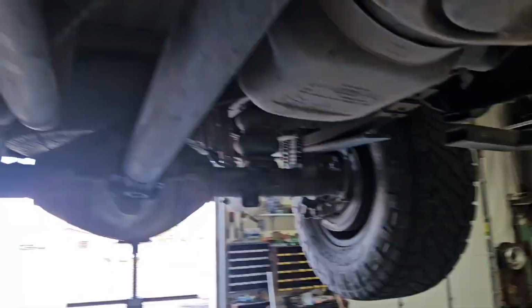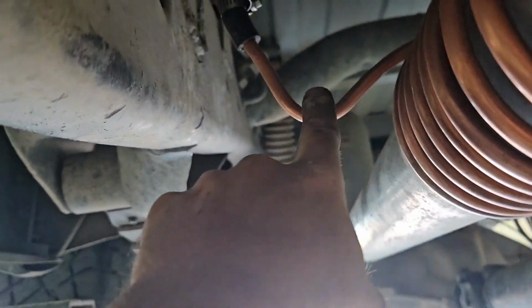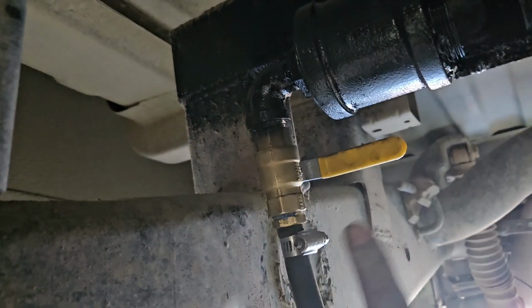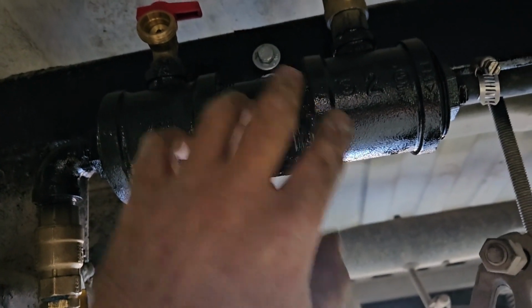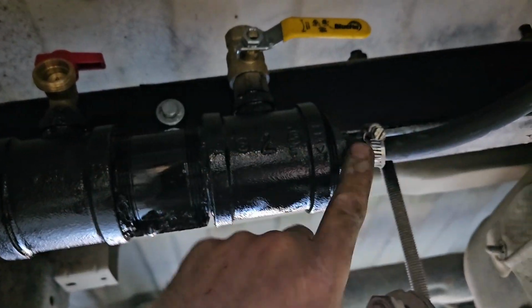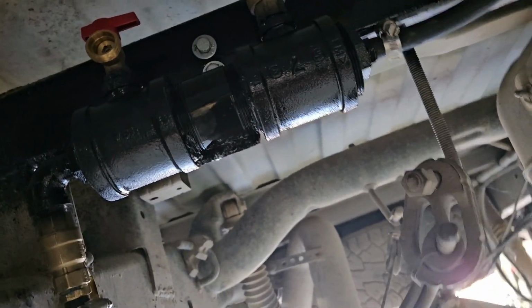Okay, so how we are. We've got our rubber hose coming from, let's go up this way. We have the rubber hose coming from the fuel pump, going through our coil. Long Z coil comes out of the Z coil. I made a little reverse bend, goes up into a ball valve, which is accessible on the backside. So summertime, don't heat the fuel. Wintertime, heats the fuel into our pressure vessel and filling ports so we can fill it and close them off. And then there'll be caps on top of that. Out of the pressure vessel, back to the fuel pump. And roundy round the hot water goes.